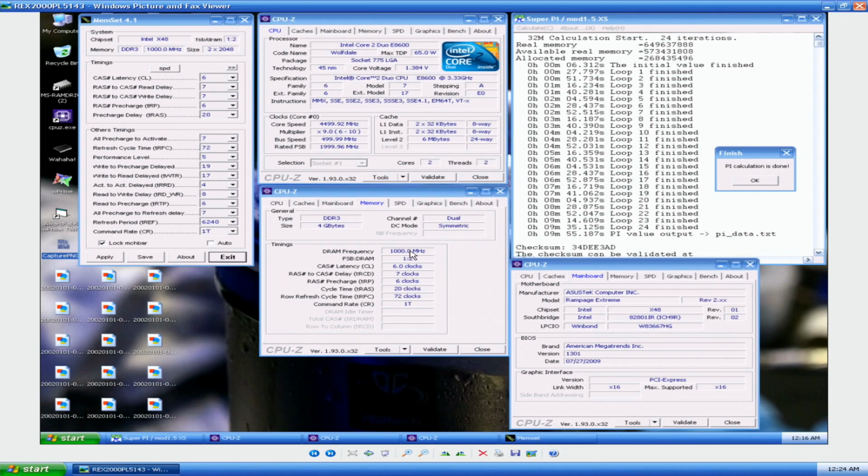and the board was able to do the same, well, roughly the same 2000 MHz memory configuration with performance level 5 on the first attempt with only 1.45 volts on the north bridge. So very good result already on the first attempt, and the lowest north bridge voltage required for this particular configuration was only 1.41 to 1.43. That's an extremely low value. It's roughly the same as my Team Finland edition.